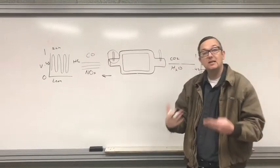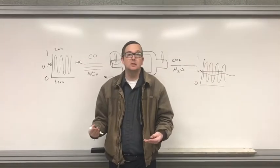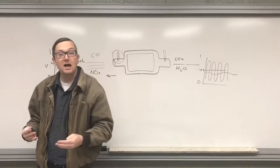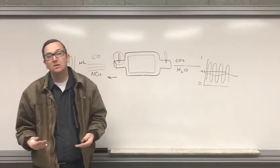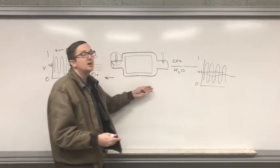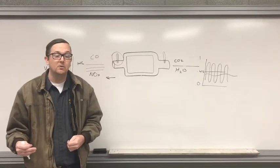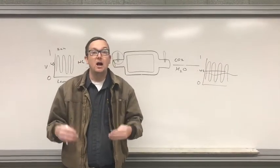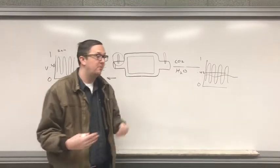This is how we diagnose this problem — if we see the rear O2 sensor going crazy. Now, there could be other problems causing this code. If you have an ignition misfire and the catalytic converter is getting overloaded with fumes, you may have an issue. If you have bad oxygen sensors — if one is dead or reading really weak — that can also give a P0420 code, and that may be accompanied by an oxygen sensor code as well. If you have oxygen sensor codes or misfire codes alongside a P0420, you need to look deeper and not condemn the catalytic converter. These are very, very expensive — they're full of precious metals: platinum, palladium, rhodium. That's why they're high theft items, so make sure your sensors are working correctly before you condemn the catalytic converter.